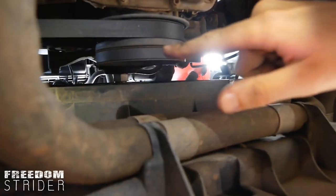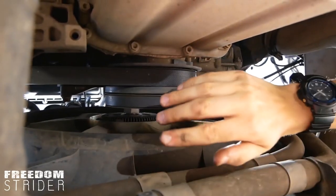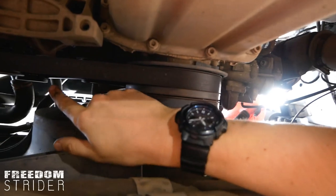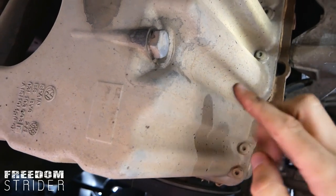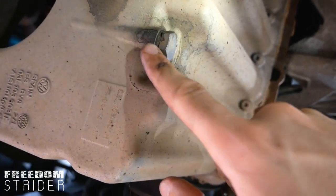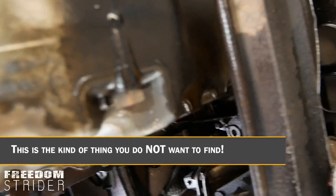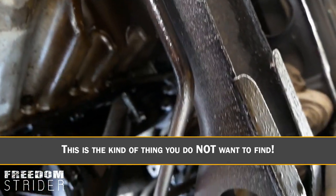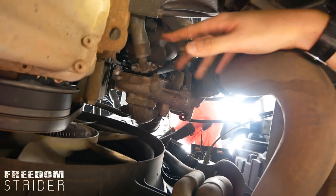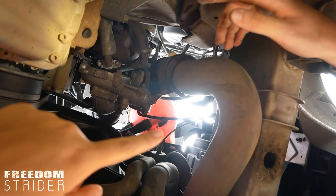Welcome to the underneath of this Crafter. Try to locate where those liquid reservoirs were on top of the van, but liquids drip everywhere when they leak so just look around, especially down running pipes. One of the most important things to check is the oil sump reservoir — when they change the oil, they unbolt this and all the oil drains out. There might be some dried residual oil from the last oil change, but if there is new, fresh oil dripping down — either leaking from this plug or from further up in the engine bay — that could be a problem. Oil leaks can be caused by loose or worn-out bearings and worn-out seals, which could be an easy fix, or it could mean your engine is dying.